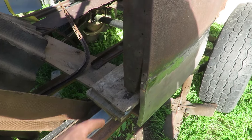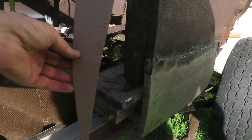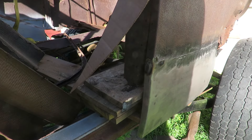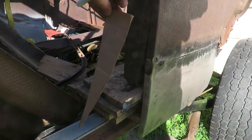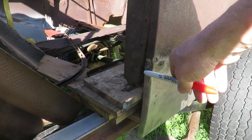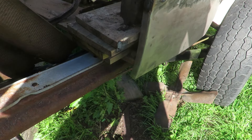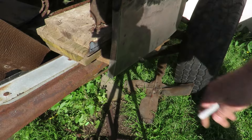I'm going to go ahead and start getting my markup for this. I already have a piece I can copy from the other side. Here's the piece — it'll actually just sit in there way down here. I'll make it this full width, and then after I get it mounted I'll line up where the straight edge is right here, cut it off, and that's what my piece will be. This piece has got to have an offset right here so that the skin can sit into it, and then it'll rest in the very bottom. Then we'll drill some holes, rivet them all together, and then this bottom half of the B pillar and the little panel patch will all be done for today.